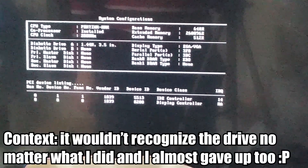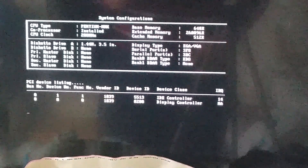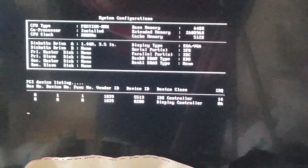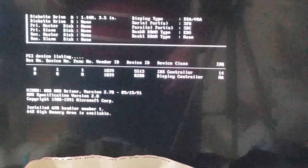I have one last thing to try. I have Seagate's low-level formatting tool on this HDD utility disk, and even though it's branded by Seagate it does seemingly work with any drive in general. We'll try using that. Since this drive didn't come with its original controller, I can't recover any information from it anyway. Let's type DIR — there is Seagate format. Let's run ATFMT4.